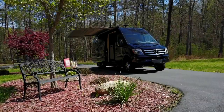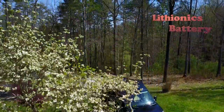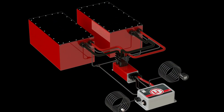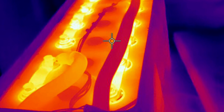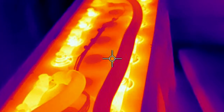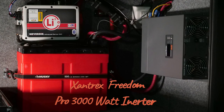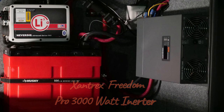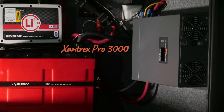When it comes to batteries, Lithionics is the oldest and largest supplier of OEM lithium cells in the industry for RVs. Lithionics performs numerous tests on each cell before assembling into packs. The battery pack and BMS are then tested together and cycled numerous times under full load, while undergoing infrared imaging to make sure heat dissipation is equal and all cells meet specs. On our Lithium Light system, we use Xantrex's new Freedom Pro 3000 watt inverter charger — let's look at a clip comparing it to the Magnum inverter.